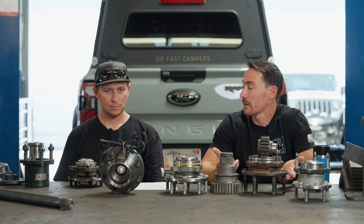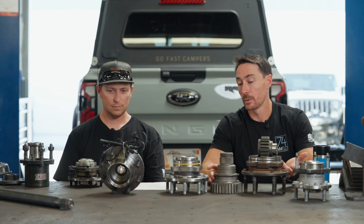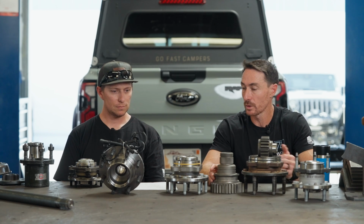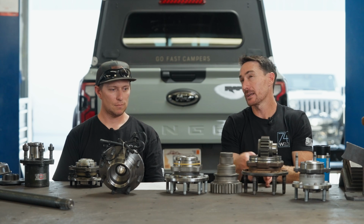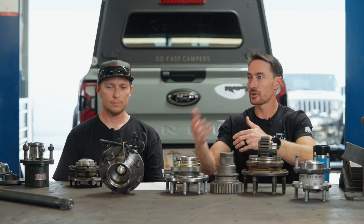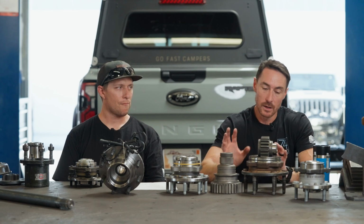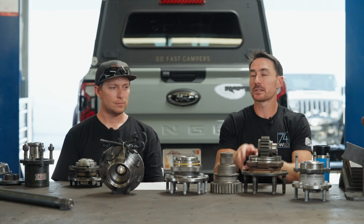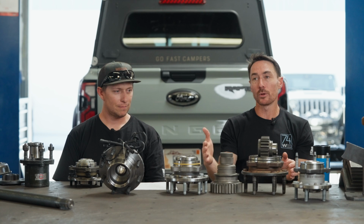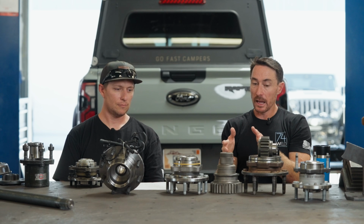So then I approached X-Track at King of the Hammers one year. We sat down, talked, and I said, hey, I want to build a portal around your gear set. I know you guys make good stuff. So they gave me a price and said, sure, we'll sell to you and to ID Designs. And then the ID Design stuff was kind of adopted by a couple other guys that went through, and that is essentially what ended up on that Jimco truck that Rob Mack is now racing, I believe. But that design is also a 3-bearing. Yes. And it's a spindle that bolts to the upright. You have a spindle carried through, you have 2 opposing tapered rollers in that, and it's a really good design.